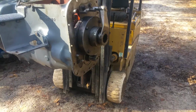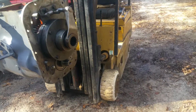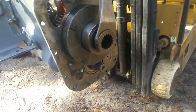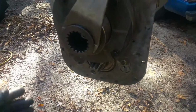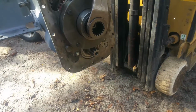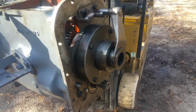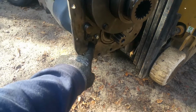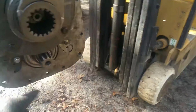I'm going to talk about the fluid running from the rear end to the front end of the tractor, between the rear end and the gearbox. Somebody may be having problems as you mow downhill. The hydraulic fluid runs through these big holes right here, and then if you have a pump that runs your PTO, you don't have a live PTO, so what happens is the hydraulic pump stops picking up, and then your clutch packs in the rear will not transfer fluid. So here's what we've come up with.